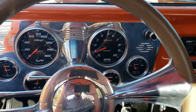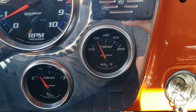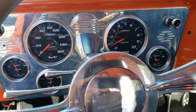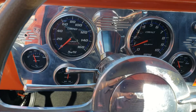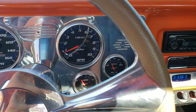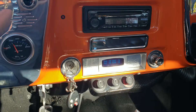Just like any older vehicle without an electric fan, you've got to watch your water temperature. If you let it sit and idle for too long it could obviously overheat a little bit — that will not happen if you're driving, it's just if you're sitting around idling it needs the airflow coming through. Everything works as you can see. If you have any questions just give us a call and I'll walk you through it — that's all the big stuff.